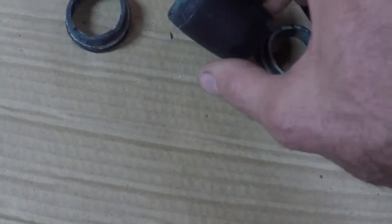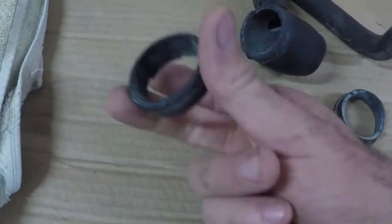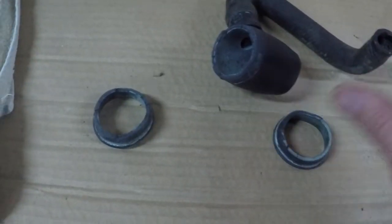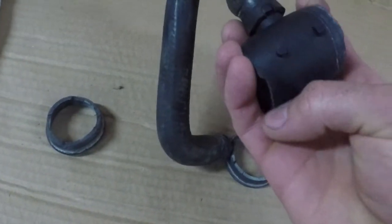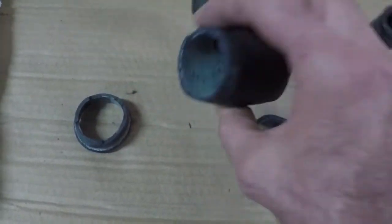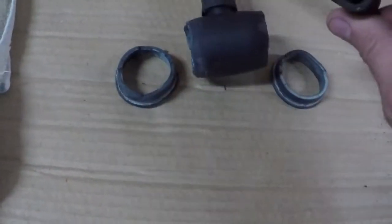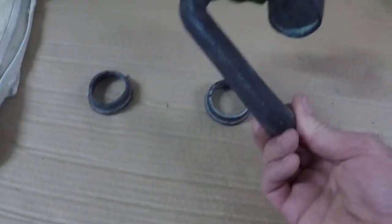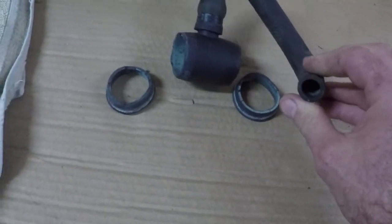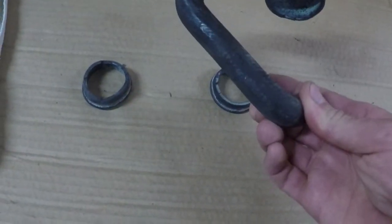It was probably this longer side here. But I didn't realize that this piece here and this piece here were stuck in the radiator hoses. So it doesn't have any kind of real retention feature, and eventually it just blew again. Boom. So I went online to find this part, and this is like a $100 radiator hose. You can't just buy this plastic piece by itself. So let's see what we can do here.